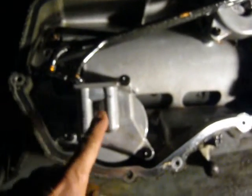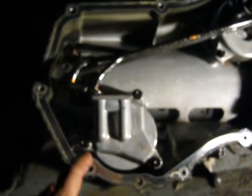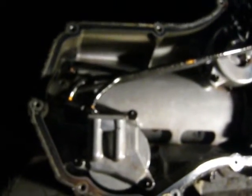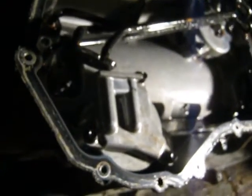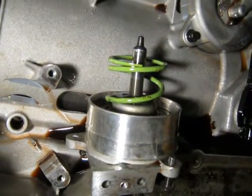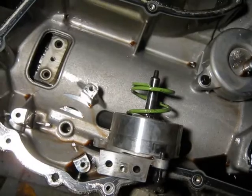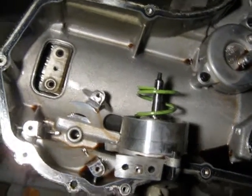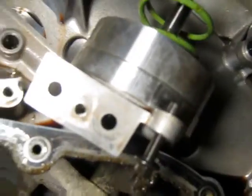One other thing — just a caution. I'm doing the bolts on the servos, loosen them up slowly, going from one to the other to the other. Because there's a spring in there and it'll push it. You don't want it to come undone all at once and have it hit you or go flying across the room. And there you see — I was right. There's a great big spring in the back of that piece I was unbolting. So it's a good thing I undid the three of them in a sequence, loosening each up a little bit at a time working around in a circle. The bolts holding the servos in are about an inch and a half long.